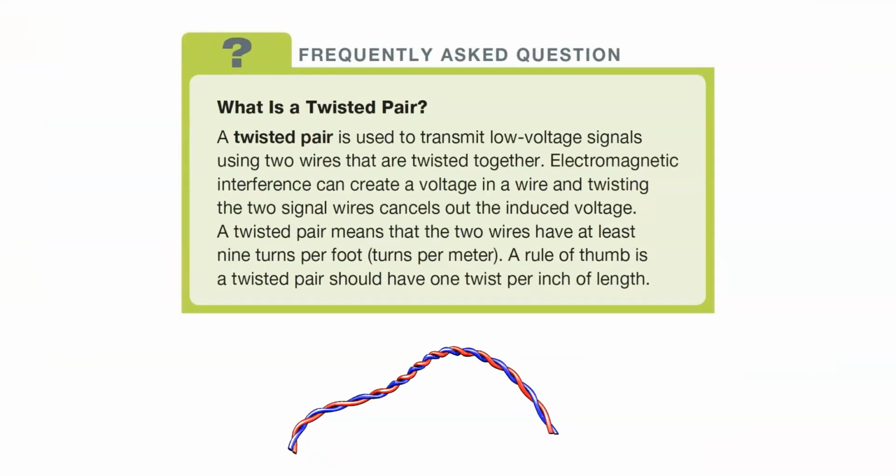So when you had brakes, you learned about wheel speed sensors. And one of the things you learned about them, and you even did it in class, is that it's a magnetic sensor. That magnetic sensor makes AC voltage as the tone wheel spins, and you get a faster and faster wheel speed. That creates a circumstance where your stereos could start sounding terrible. Not to mention AC voltage getting involved in some other things. If it can affect speakers, it can affect other electronic components. So anytime you see wheel speed sensors in a car and you look at a diagram, you will see them indicated as a twisted pair, and you'll see the wires cross over each other all the way through the diagram. The same way a ground strap kills AC voltage, so does that.